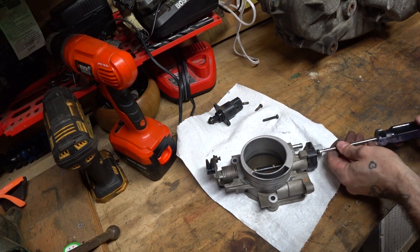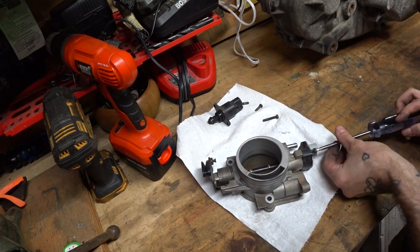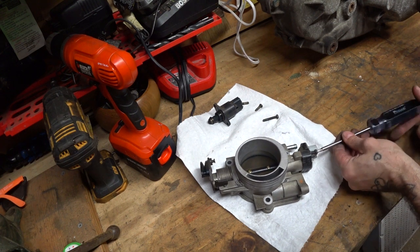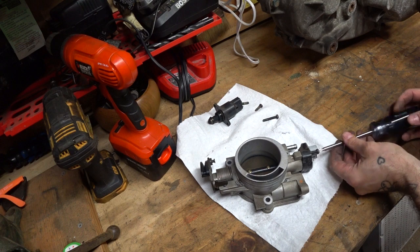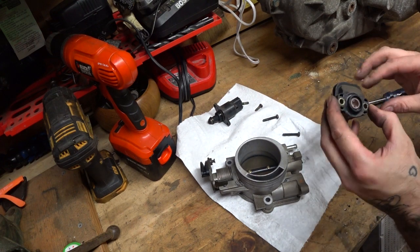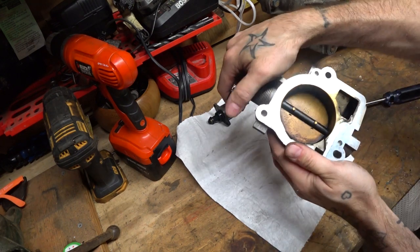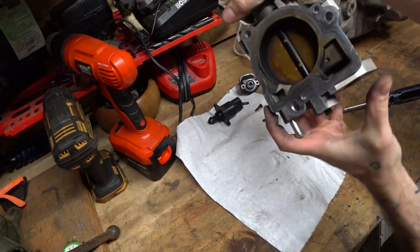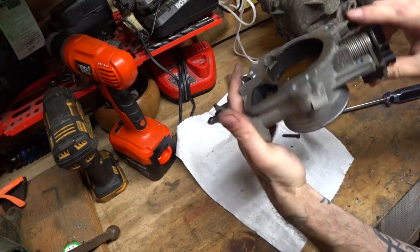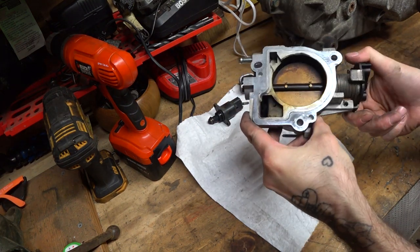This Jeep is 18 years old, it's got 125,000 miles, and I can tell by how tight these screws are that no one has ever cleaned this throttle body. So this is 18 years' and 125,000 miles' worth of junk. There's nothing to really clean on the TPS sensor — you just sort of put that one aside. Now looking at this throttle body, it's actually not that bad, but it definitely does need to be cleaned. Considering it's likely never been cleaned, cleaning it out will help throttle response and can help everything run real nice.